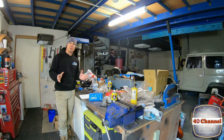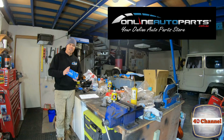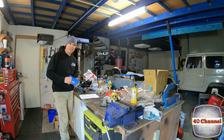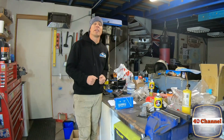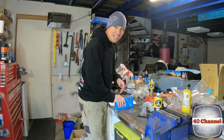So what we're going to do, we're going to get our tie rods, we'll replace all the tie rod ends, and of course all new relay rod and tie rod ends from Online Auto Parts. So we'll check out what we've got, put it all together, get it back on the car. We're also going to make sure we get all the measurements right. We're going to measure it all up so we get our toe in perfect, so we don't get too much tyre wear or any crazy vibration coming up through the ute as well. Let's start getting into it.